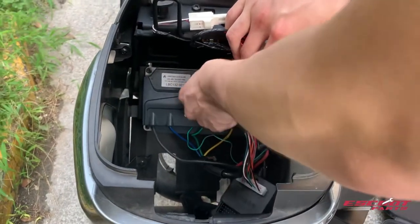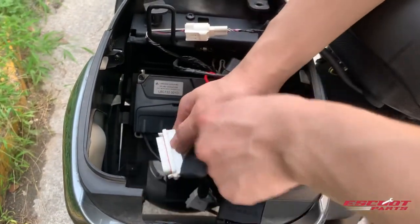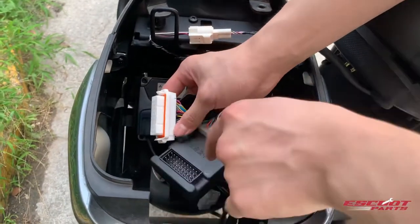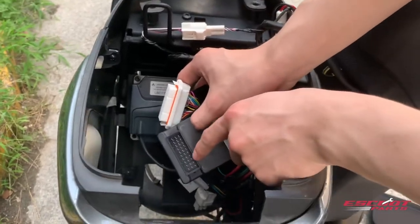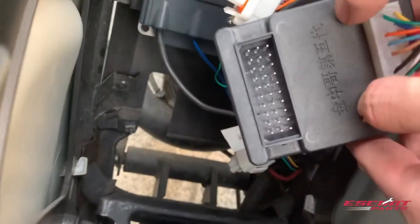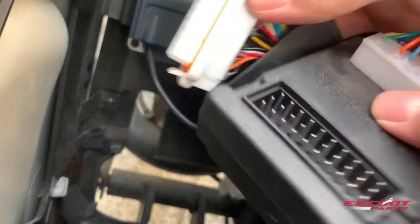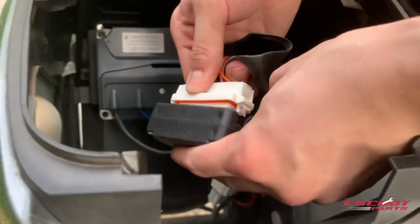Next, you will have to put the scooter cable into the black box. Notice that the cable of the scooter also has two lines indicating which direction — the lines have to face outwards of the black box. Notice that for our boxes there are actually indents so you cannot mess it up. Although the original motherboard has four screws to secure it, two screws is totally sufficient.